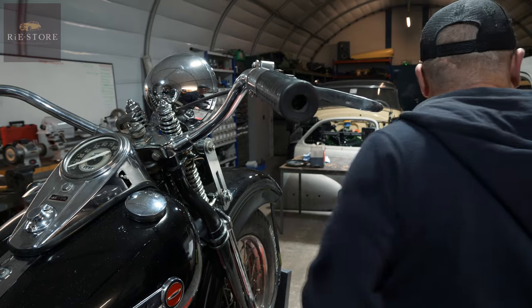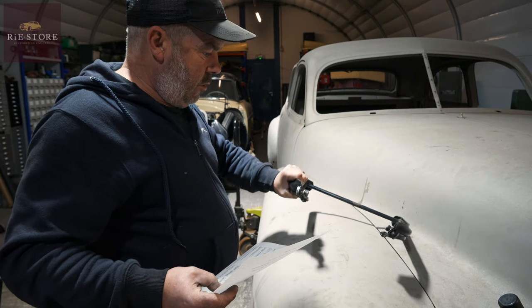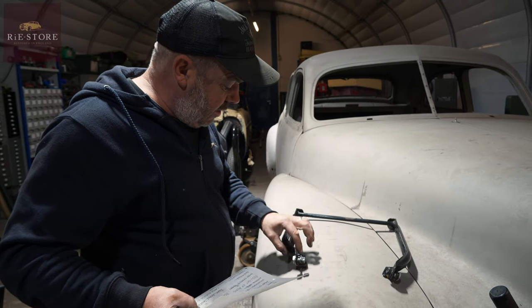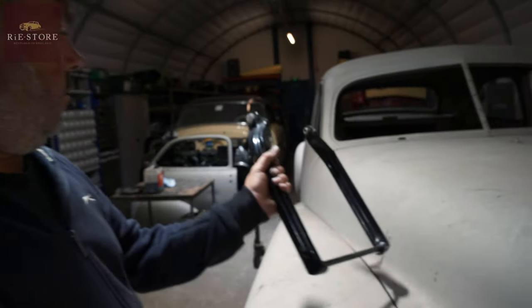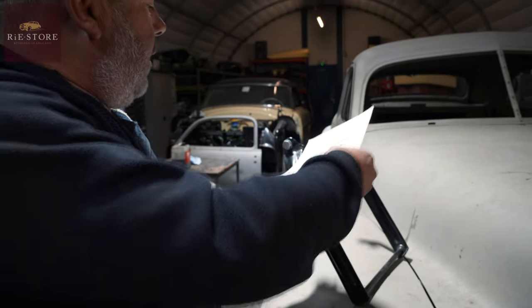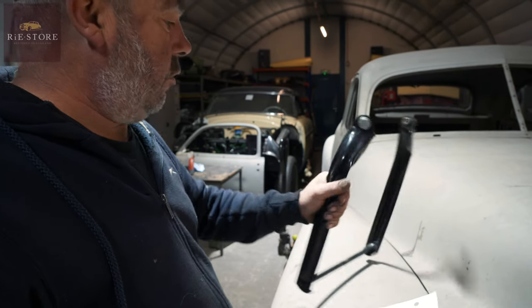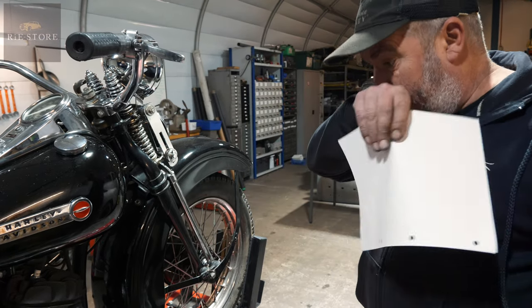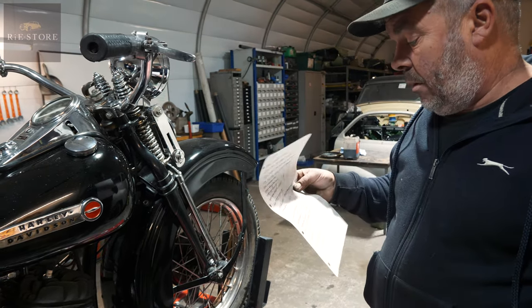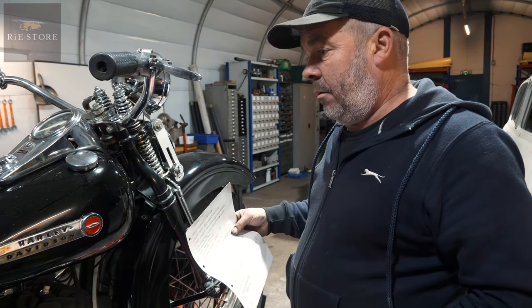Correct engine. Rear stand bent to hell as usual on the Harleys — it's crap. So I'll straighten that out; you can put some braces in here and make them stronger. As the stand goes down it bends and buckles — once they're bent they've gone. You can just straighten them out and try to put some bracing in. It's had a belt drive fitted instead of chain drive for the primary, which is always good — quietens them down.